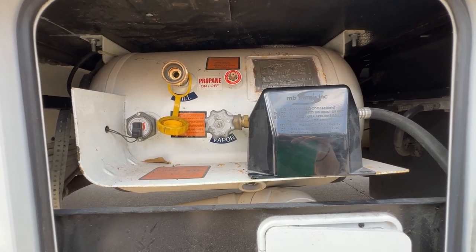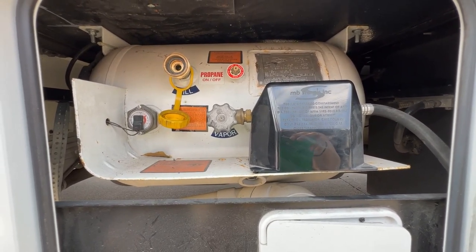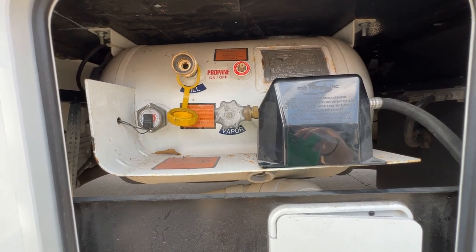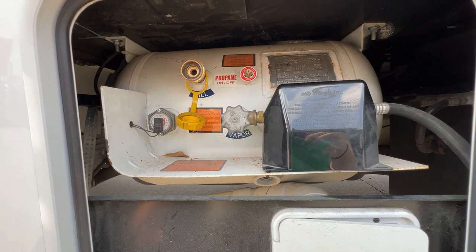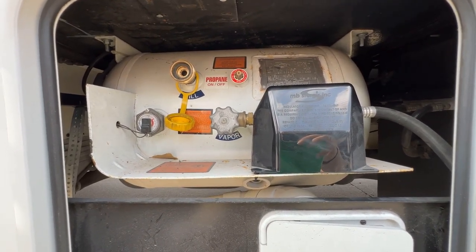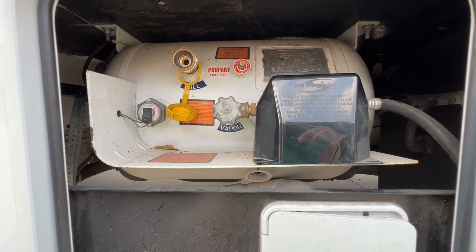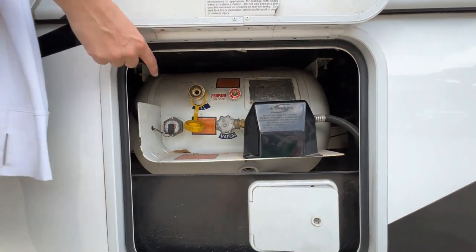The fuel size of this tank is 16 gallons — so this is a smaller tank. Typically if you're going to be dry camping, two to three days running on the generator tops. So you really want to keep an eye on this. Make sure you don't die in the middle of the night with no AC. Make sure you keep a close eye and be checking this every day.